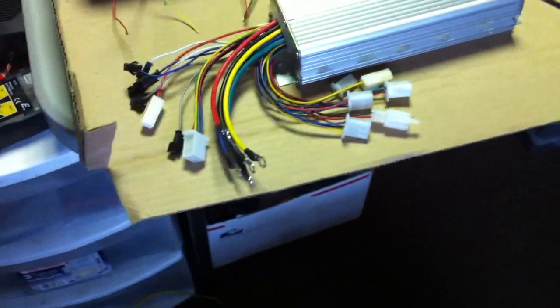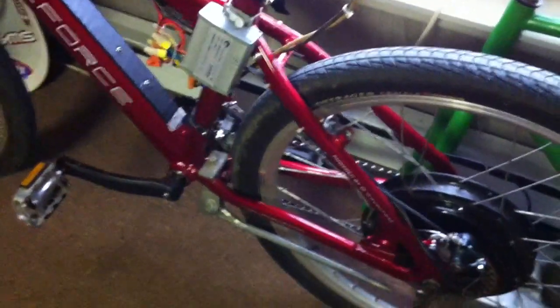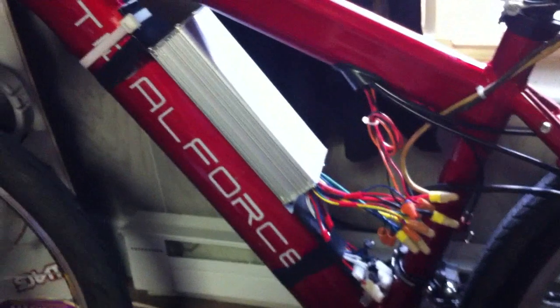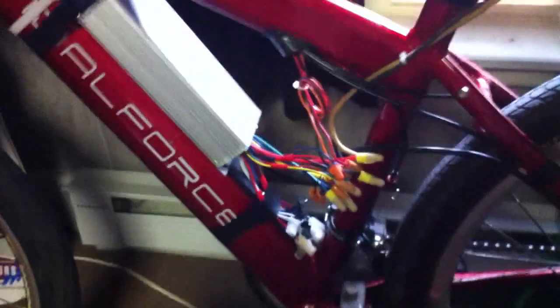I'm going to cut off all these connections I don't need. I brought my bike back up here and I'm going to pull this little small controller off and see what this thing can do. Alright, so I pulled the old controller off. I have the new one on and temped out with electrical tape. I have all my connections done. I even threw on this cheesy rear rack and I got my battery in there. And I'm going to take it for a spin.